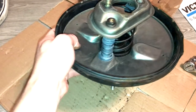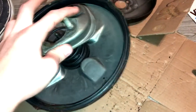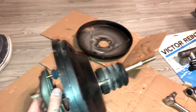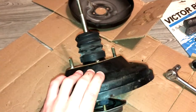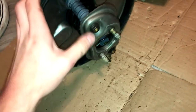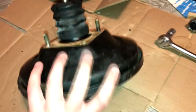It's pretty soft after all these years, and this whole thing can actually move relative to the chassis of the brake booster. This metal plate is connected by this rubber. Through this plate up here we have two studs that go through to the back. If you're taking one of these off, there are four studs that come out the back — these go all the way through. When I pulled the front cover off I relieved the spring of its compression. There are some sort of lock nuts on the back, so I'm going to put some M8 nuts on the back here to hold these steady so I can get them loose properly.